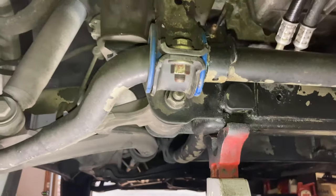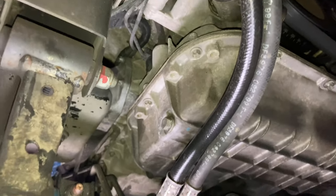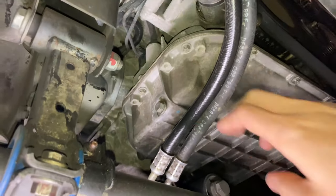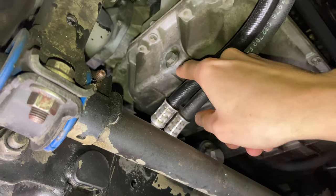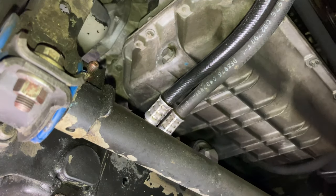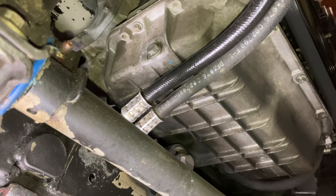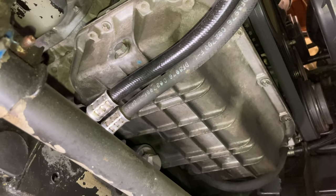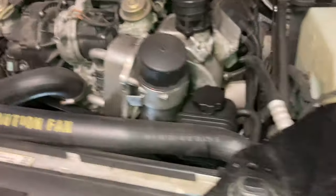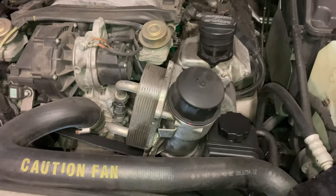This car is in good shape for how old it is. Besides the peeling weatherproofing coating Mercedes was doing back then, the underbody looks fantastic — for a 20-year-old SUV that was doing winter passes pretty much its whole life, it's solid. Here's the drain plug. The nice thing about the ML55 is there's only one drain plug versus the C55 and some other M113s. It's a 13 millimeter and does not use a gasket or copper O-ring. I ran it without one last time — from looking online it seems like you don't need one for this motor, and it's been dry — so I'll do the same.